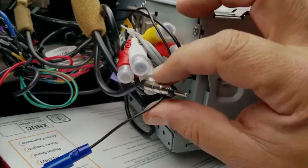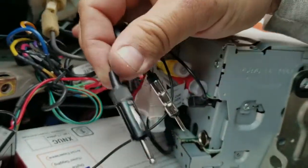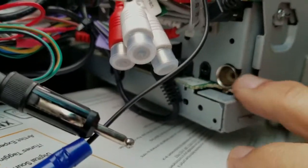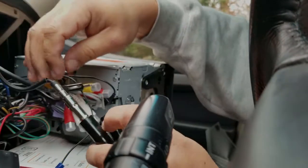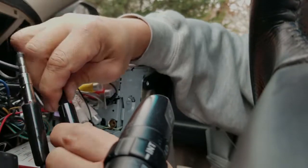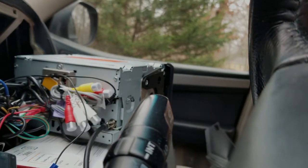You can see in the back here we have the original antenna cables for the 2005 4Runner, and there are two of them. But the radio only has one plug — that's where the diversity antenna connector comes in. It's connected. Now I'm going to connect the AM plug and the FM plug. That's connected, so now these two cables go into one connector right here. Now I should be able to have AM and FM radio.